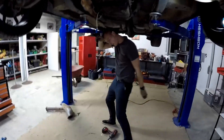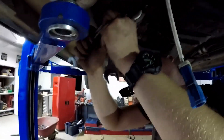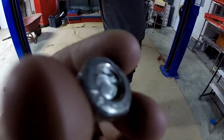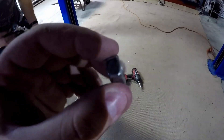So the dump pipe being a cheap one doesn't quite line up, so we're just fiddling with positioning. Something really strange happened with one of the bolts - one of the bolts randomly decided not to undo. I could literally turn it by hand with a spanner, the whole bolt, quite easily, so there can't have been much force on it. But that end of the bolt actually sheared off inside the nut. We just gradually got bigger tools because we couldn't get the stupid thing undone, and it was a brand new nut and bolt. Cold welded. Done.